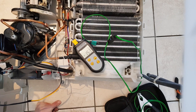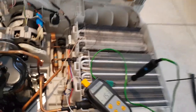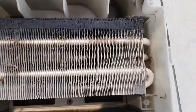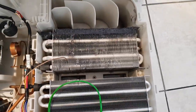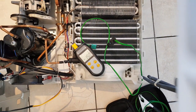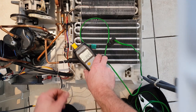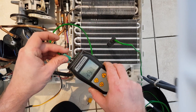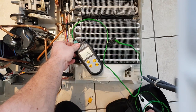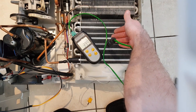There's no heater at all in these dryers - just a dehumidifier. You do get some heat but it's a by-product. What it does is suck heat out of the air coming through - as you can see, the evaporator gets really cold. When it's running, the airflow will keep it from icing up, but it acts like a cold can of coke on a warm summer's day - moisture in the air condenses on it. Then when the air comes through the condenser, it heats up again with the heat expelled from the refrigerant plus waste heat from the compressor.